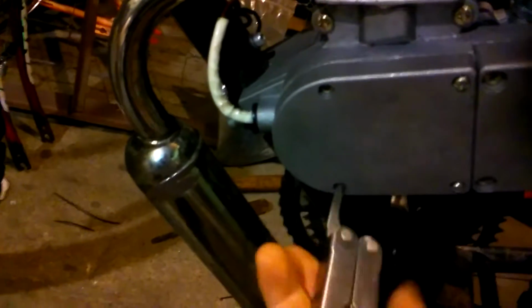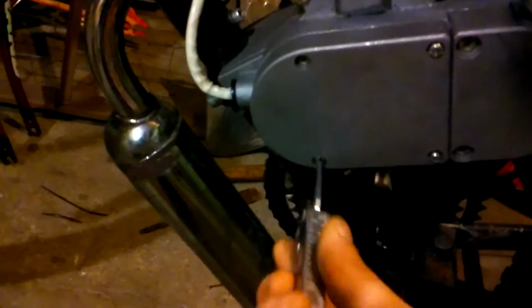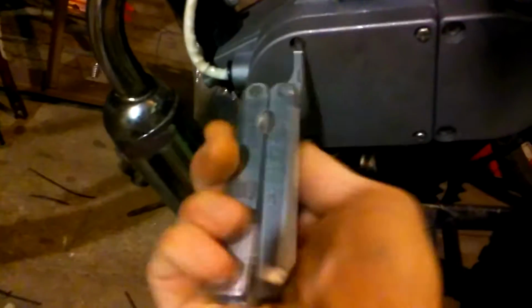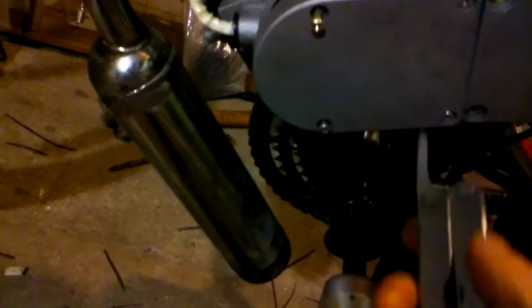If everybody's talking about loss of power, yeah, you're going to lose some power. You're not going to lose much, but yeah, you will lose some performance. No energy's free. You want to run a wheel dynamo? Go ahead. Watch it burn up. You're lucky if the thing doesn't catch fire. They're not designed for a motorized bicycle. On top of that, you're just going to tear your tire up faster than it needs to be torn up. You'd be replacing tires like crazy. I know. I used to use one of them when I was a kid. They were cool then. Yeah, we're talking back in the 80s.